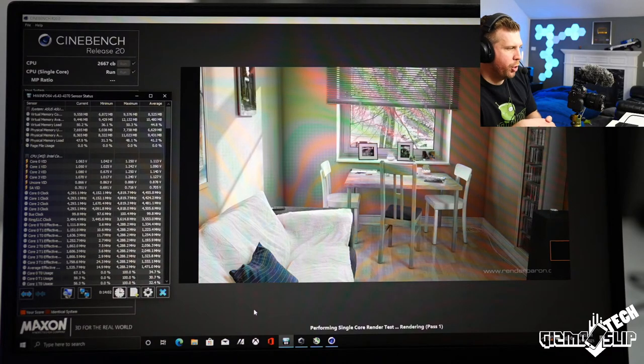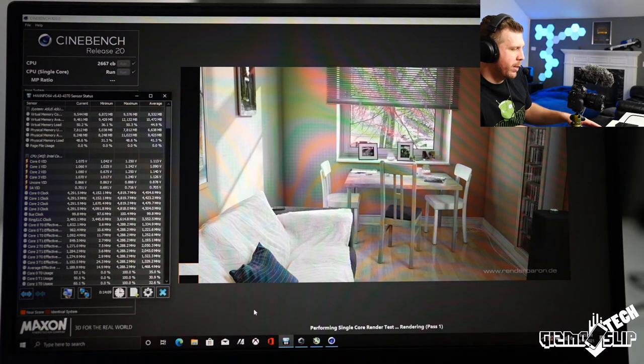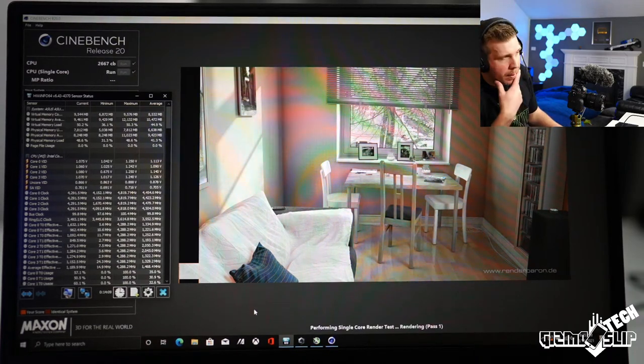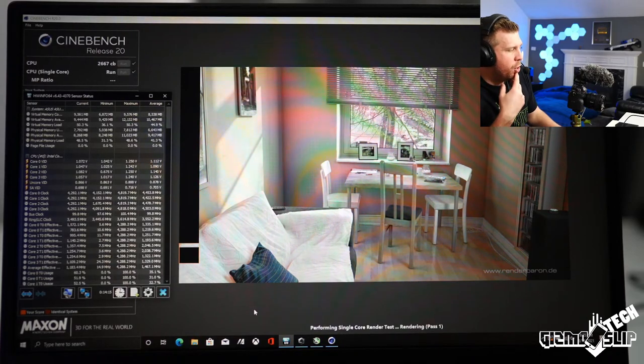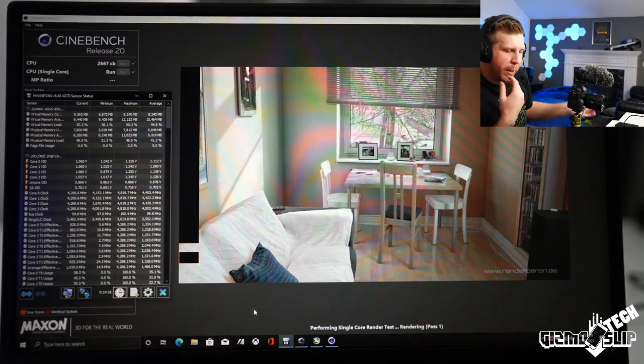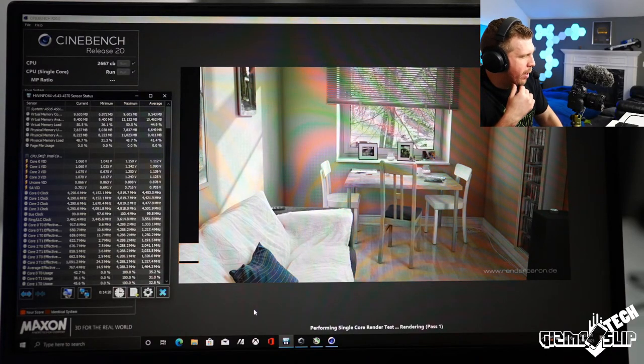And then in addition, if you do tons of esports games, I would highly recommend a MUX switch in your laptop. But pretty much only the more expensive laptops have the MUX switch. Nothing around this price point has a MUX switch, I think, except maybe the Omen 15T. And then the next cheapest would be the Aorus 15G. So it depends on what games you play. If you mainly play AAA titles, then you don't really need a MUX switch as badly. If you play lots of CPU-bound games, that's where a MUX switch is really, really important.